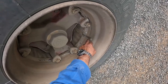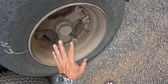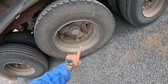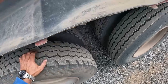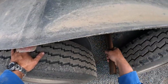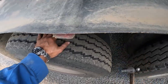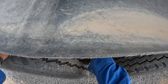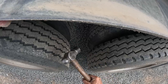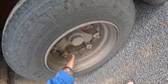These will slip. We always try to keep the valve in the middle so we know if the tire's been slipping or not. I haven't put the yellow tags back on this one because I've changed it over, but I've been checking the nuts quite a few times. I'll be putting the yellow tabs back on now. What I'm listening for — if the tires have a very different sound. You want that hollow, pumped sound. You don't want a dull doom — totally different, meaning it's flat or lost pressure. I quite often check them at the end of the day and go around and check the hubs as well.